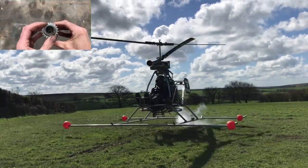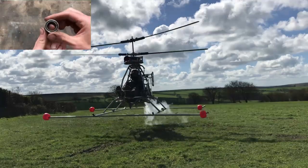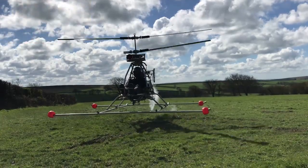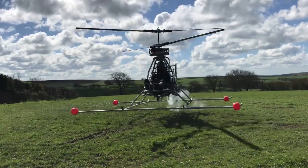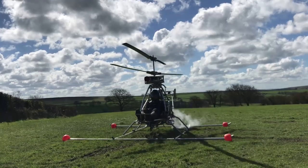In part 3 I tested a one-way bearing that I want to install as a rotor overrun. I want an overrun mainly because it's a good idea should the engine ever seize. I know I nearly caused an engine seizure on this occasion — it might look like a steam-powered helicopter in the video, but it was in fact coolant leaking from a hose at an alarmingly rapid rate.